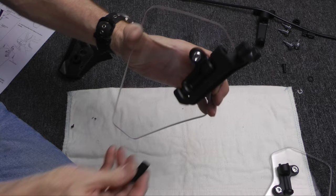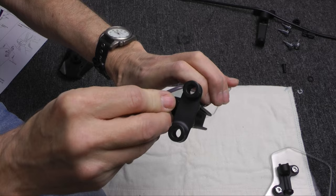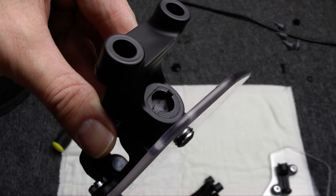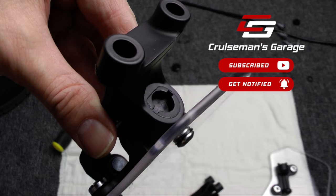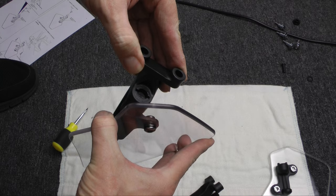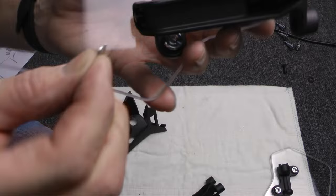Now, this fits in place long side first down into the opening. When it's installed correctly, you'll see that it's recessed inside the bracket. To do this, I recommend you use a small hammer and maybe a Phillips screwdriver on the head of that damper to tap it down into place until it bottoms out. When the damper's installed correctly, you should be able to swivel the bracket as shown. Here I'm installing the pin and the E-ring on the bottom of the bracket.